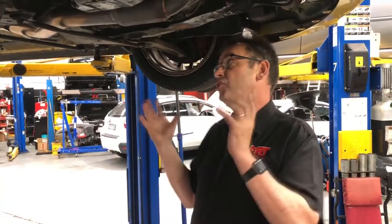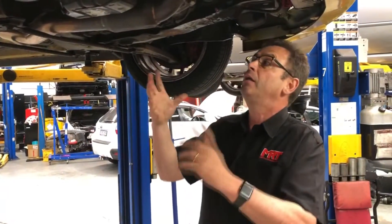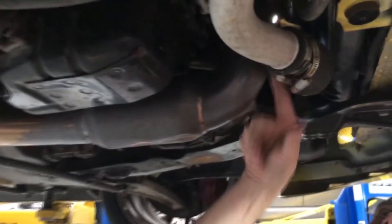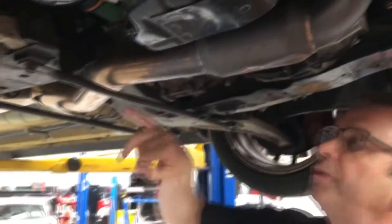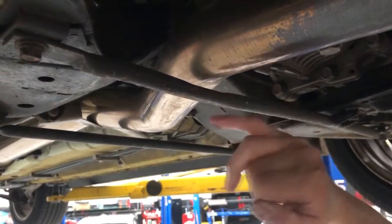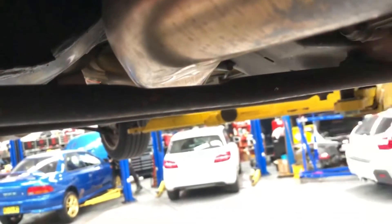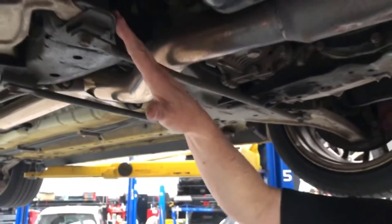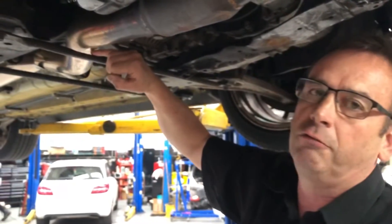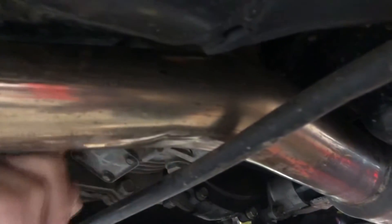For today I want to show you what's included in the XB kit. As you can see on this particular car, we supply and fit a new downpipe off the bottom of the factory outlet and a high flow catalytic converter. Mitsubishi were quite smart when they designed the car — there's actually a relief in this crossbar here that allows a bit more clearance for the exhaust system. Everything above it is moving when you're accelerating and decelerating, and the whole thing rocks forward and back. Our exhaust system also includes a relief on the three inch design, because we want to tuck it up as high as we can to increase clearances so you don't have any annoying rattles.